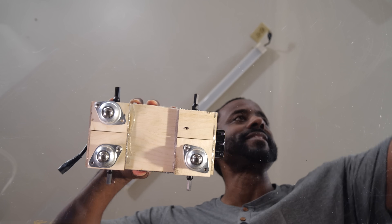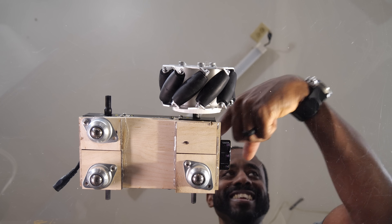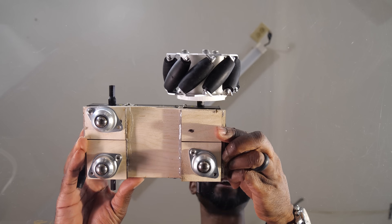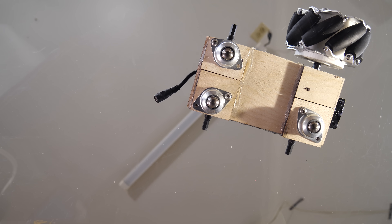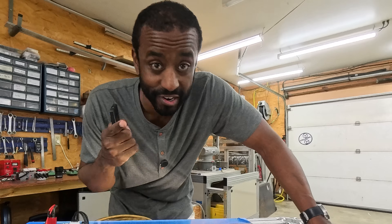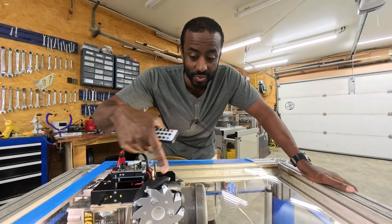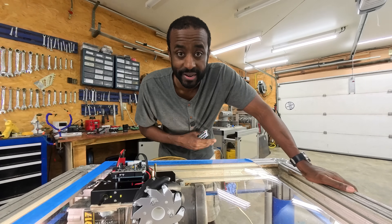Let's try the left-hand version of the wheel. Now it should be pointed more like this — in and towards the inside of the car. We're going to spin this wheel forward. So far we've learned that the wheel definitely wants to track along the axis of the roller, because the wheel is free to rotate along this axis. It slips a little bit in that axis, but it's got full traction in the other direction, so without any other forces, it's going to want to follow that line of traction.